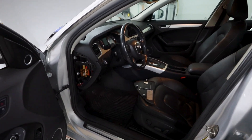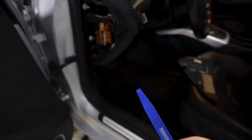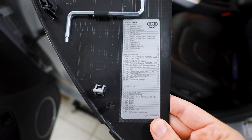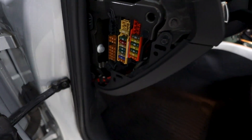Probably do something to relieve your fuel pressure. The quick and easy way is actually just removing the fuel pump fuse in the panel right there. You can take a little trim tool — there are always a couple of little clips and you just pop pop pop and you'll get this little plate off. Audi makes it really easy — there's a whole list of fuses with position, color, and amperage. Just take the little tool on your pincers and pull out the fuse. Then get in the car, start the car as you normally would — no harm will come to the engine. The fuel pump just isn't running anymore so it'll suck all the fuel out of the lines, it'll be depressurized, and the car will just naturally die. Then turn off the vehicle and get to work.